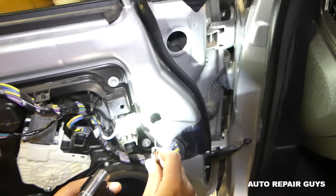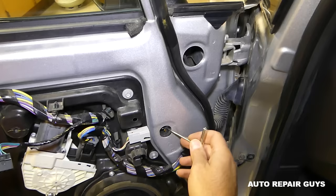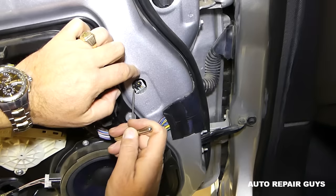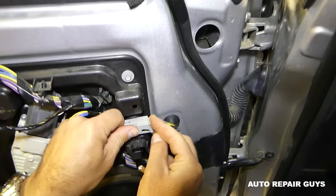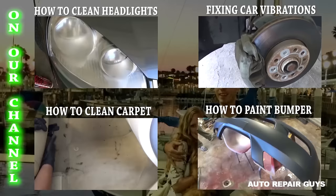You can use a wire or we have an improvised wire puller here — grab it like that. It's a little complicated, more complicated than it should be on this Ford, but some things are a little hard to do. Pull it out, then grab the seal and pull it out until it gets into the groove. Go ahead and connect your mirror, install the cap, and that's the whole video. Thank you for watching — please subscribe and see you next time.